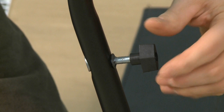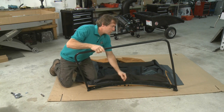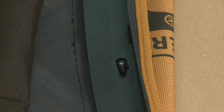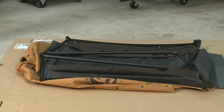Put a knob on the end of the bolt, screwed on about halfway. For orientation: the long curved section goes towards the back, and the shorter straight portion towards the front. Lay it onto the studs of the retainer so the flange is pointing up, then by hand insert the lock nuts onto the studs — you'll have five of those. Do not tighten them down at this point — we need to leave everything loose until the end. Now install the tube frame on the other side.